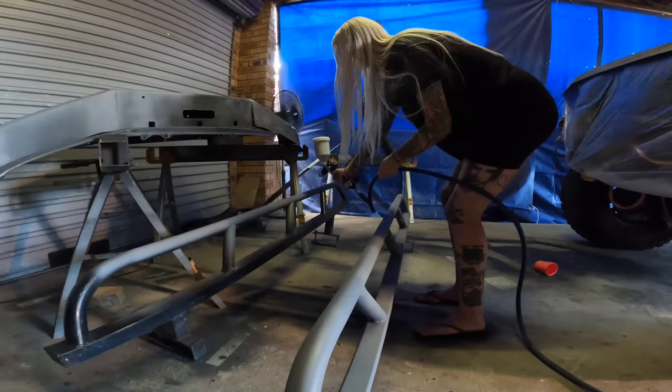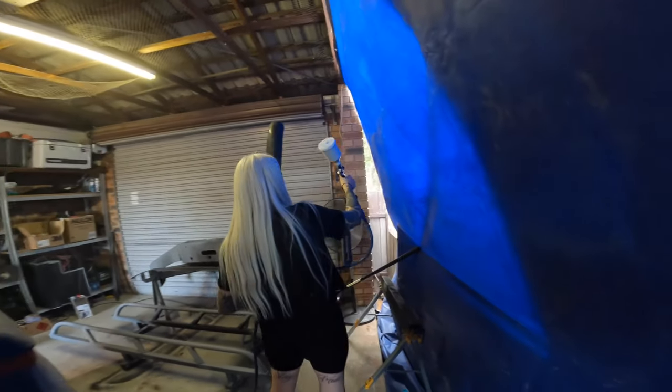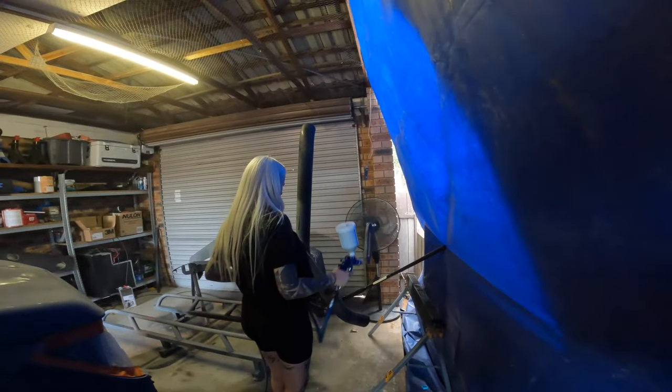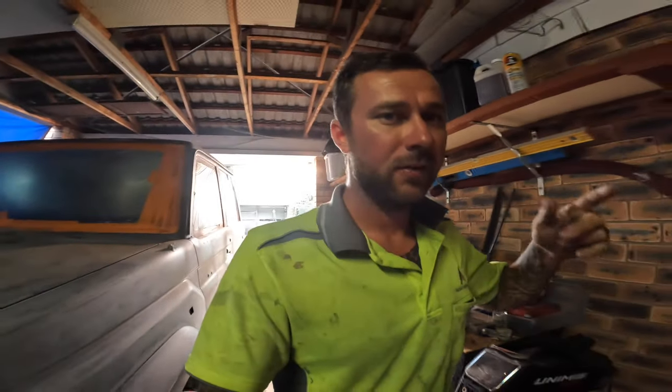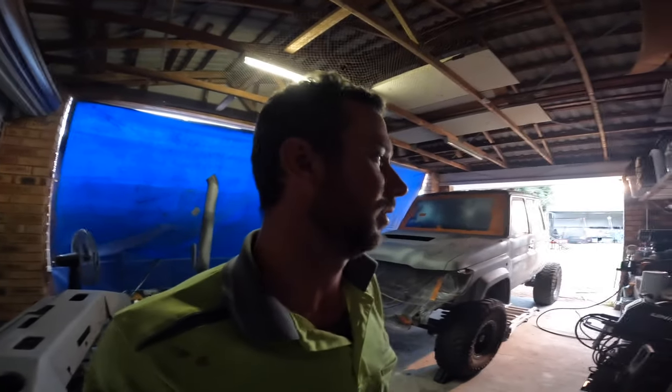If you're after a more detailed paint video, head over to Alan's other video — it's called 'We Painted Our 80 Series' or something like that, I can link it below. We also have a friend's car coming over. I've changed the nozzle from the 1.4 to the 2mm — when I opened the box it was actually a 2mm. The can recommends a 1.8 because the primer filler is so much thicker. Just mixed up our primer filler and now we're going to throw some primer over this car. It's still like 27 degrees in here — nearly breaking a sweat.